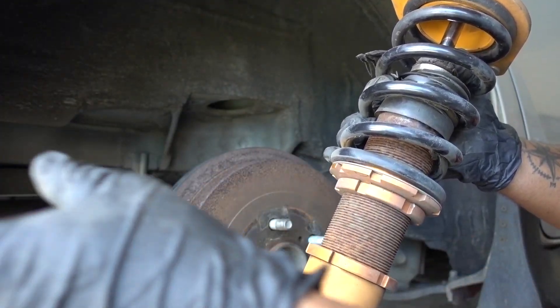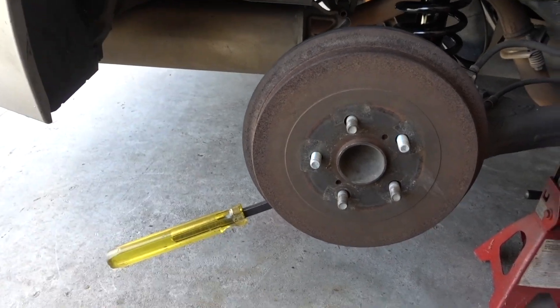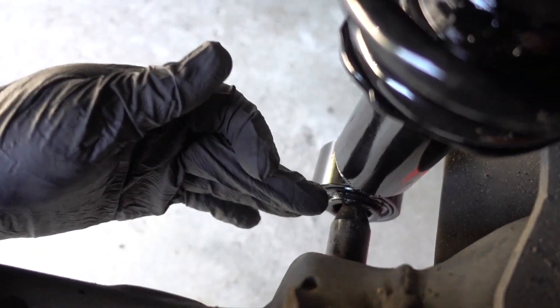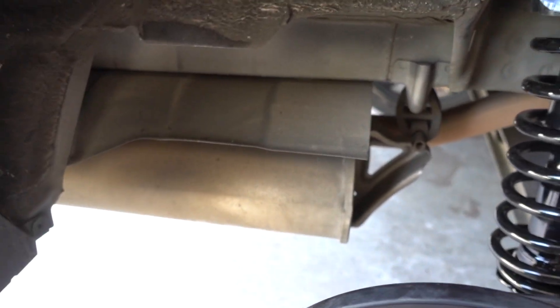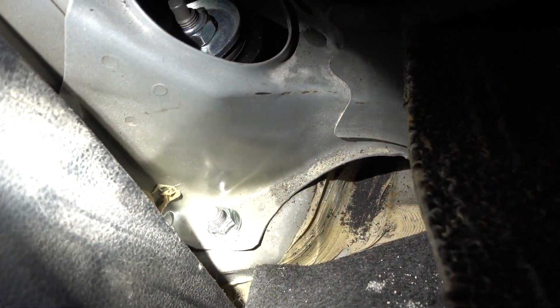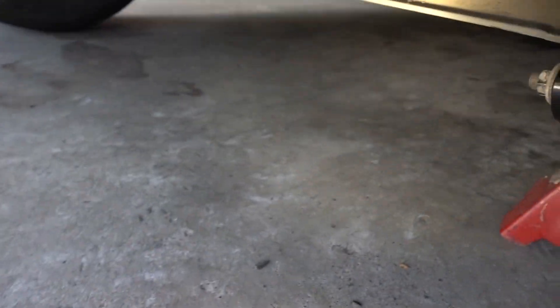Once you remove it from the bottom, you can get it out. Same thing for the installation on the new ones. The new ones are taller because it's the original suspension. Put it on the bottom first, press down, and then put the other one. If you have a cheater bar or something, put it inside that hole right there and press really hard on it. I couldn't film it because pretty much I was inside sitting on that bar while I was putting the strut in. I'm almost bringing it all the way in — I need to push down a little bit more and slide the new shock in place and tighten everything up. This is the difficult part; if you have somebody pressing on a bar in there, it's going to make your life much easier. Now it changed from 14 to 15 millimeter on both sides. The other one is on the other side, so those are 15 now. This is still the 14. It's in place and it's tied. The bottom one is already tied.